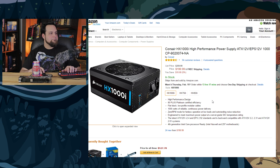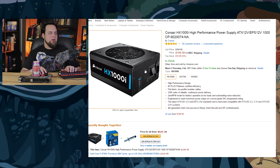I just noticed we have a few Corsair products in this build, but this one we also just got in the studio and it is solid — the HX1000, 1,000-watt power supply from Corsair. It's 80-plus Platinum certified, and one of the interesting things about it is it has digital power control on the inside. There are multiple rails, but if you want the performance of a single rail, it can digitally do a single rail.